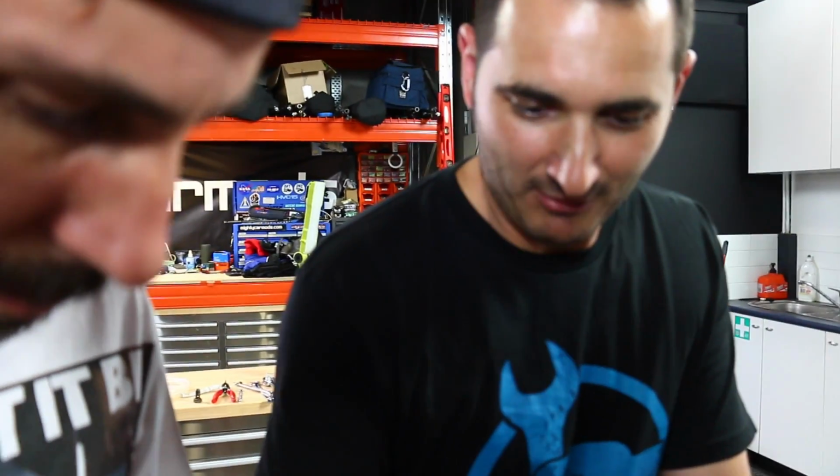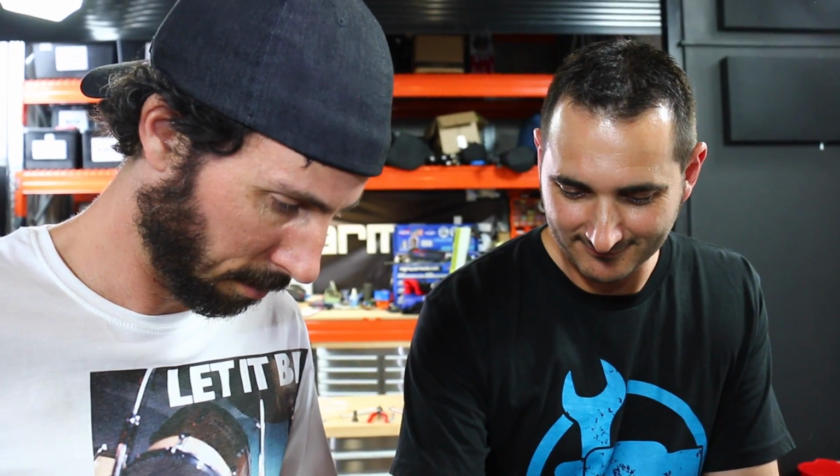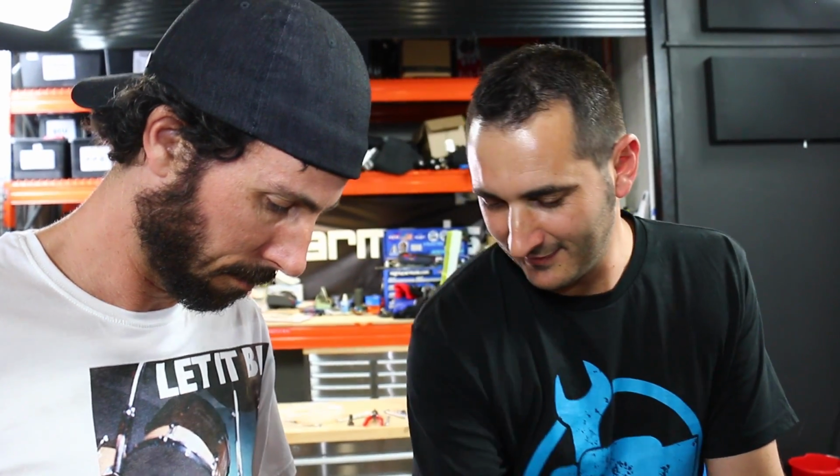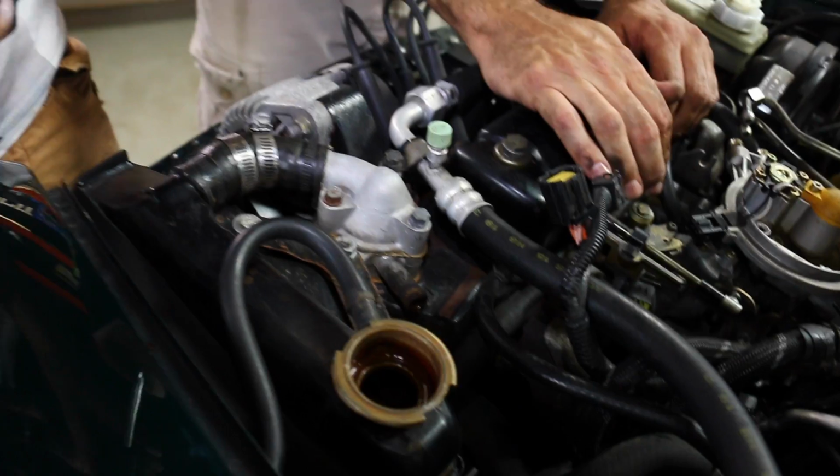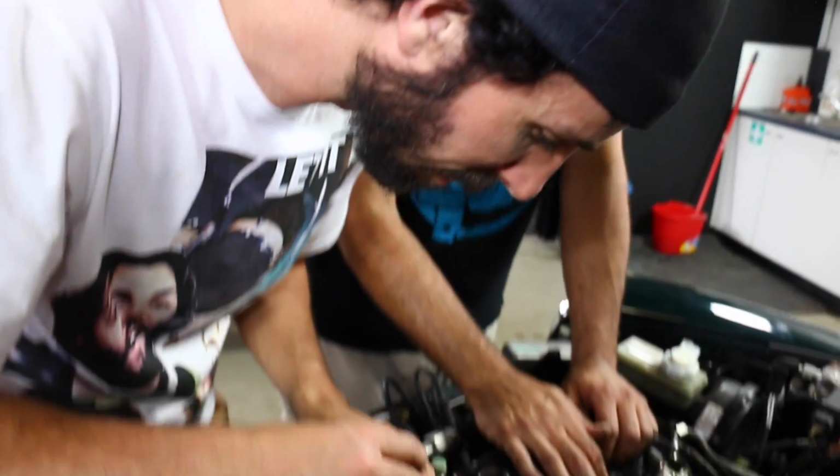The radiator doesn't bolt to the car. The radiator bolts to the shroud, and the shroud bolts to the engine. So you have to remove the bolts that hold the shroud, and then the shroud comes off the radiator, and then the radiator can come out the top, because you can't get the fan off until the radiator's out. Right, and I'm assuming all these hoses that are down here in this place that are impossible to get to unless your fingers are made out of spaghetti also have to come off first. Yes, they do. Good times. Love minis.